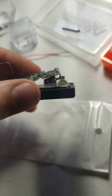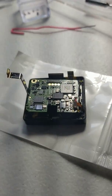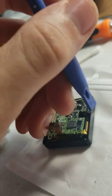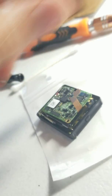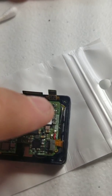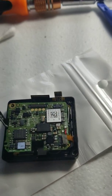After that, you want to get your battery back in place right on the side over there and get that ready, nice and laying flat in there. Next step of reassembly is getting that little vibration module to go right back where it came out of. Your plastic spudger is helpful here to align that and get it stuck right back down in there. The adhesive stuck on the vibration module so it was able to go right back down in there. You want to make sure that your three press fit ribbon cable connectors are somewhat aligned and make sure nothing is folded underneath there. There should be four ribbon cables coming out around the side of it.